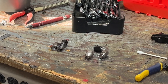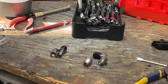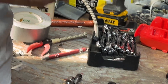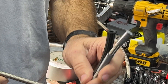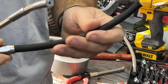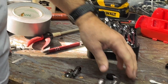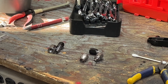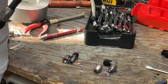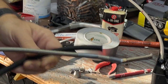Where can you get these hoses? Personally I find a good source to be Aircraft Spruce, or even Summit Racing, or some of the speed shops — they've got a lot of what I call aircraft quality hoses. Obviously Aeroquip makes them as well, but the fittings with Aeroquip can get really expensive. I find the Summit, Earl's, Fragola, and some of the other fittings more economical, and just as good — I've not seen any failures with those across hundreds of aircraft.